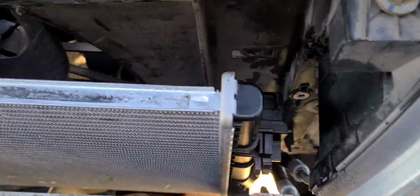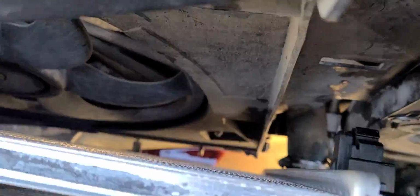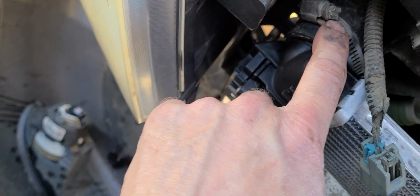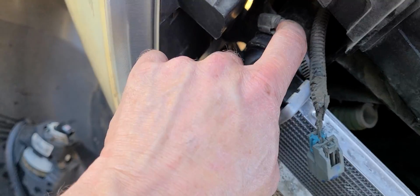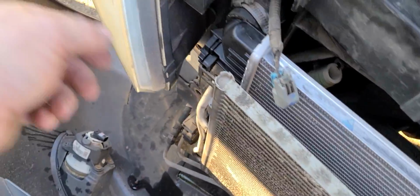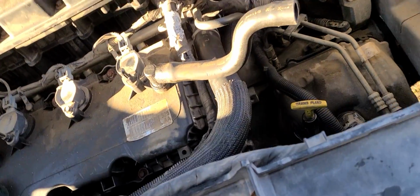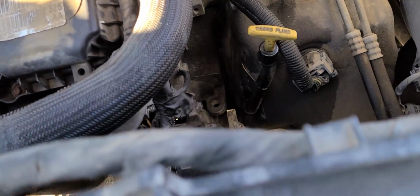All right, y'all, we're back, and I went and got some of the tools I needed, and just now I've got the hose clamps tightened up. If you don't have a 5/16 socket, you can use an 8mm. Of course, you can also use just a flat tip screwdriver if you'd rather. But here's how this all goes together. And I was looking at his fan earlier. I don't see anything terribly wrong with his fan. But that is what got into his old radiator. So the fan came out of it looking pretty good. So anyway, here we go.